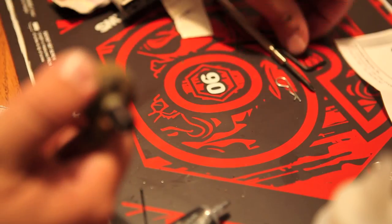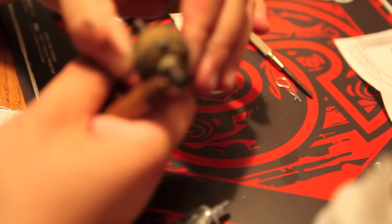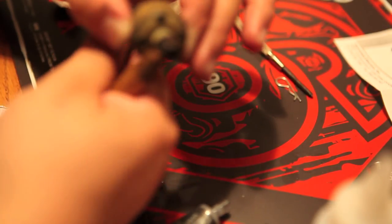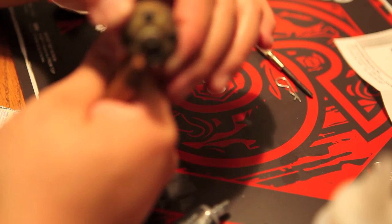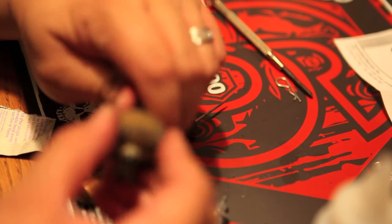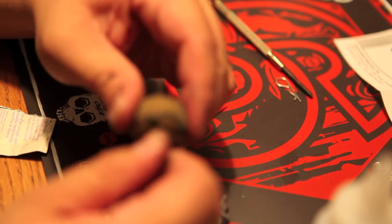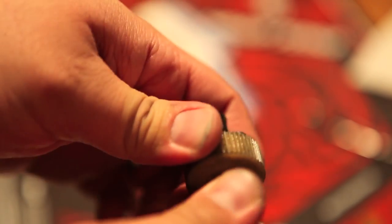I need to make sure that if I jam the two outer diffs and try to move the gear diff, it locks. There's some give but that's my fault — I'm not using a thick enough allen wrench inside the outer diff rim. But pretty much this is how you rebuild a Team Associated SC10 gear differential. If you're a beginner, this is not a daunting task — it just requires some patience, and it's a great chance to slightly modify the gear diff by adding different differential fluid. Thanks for watching, and remember, everything matters.